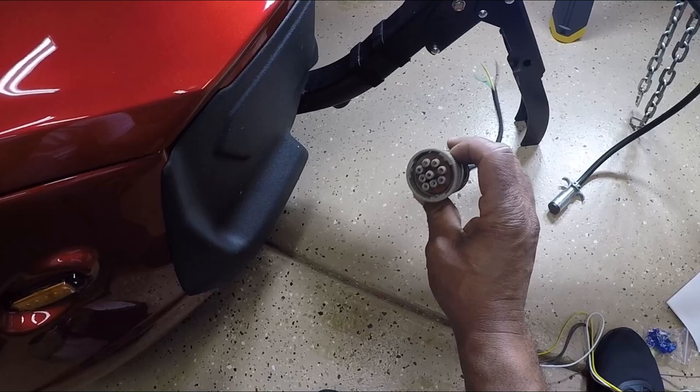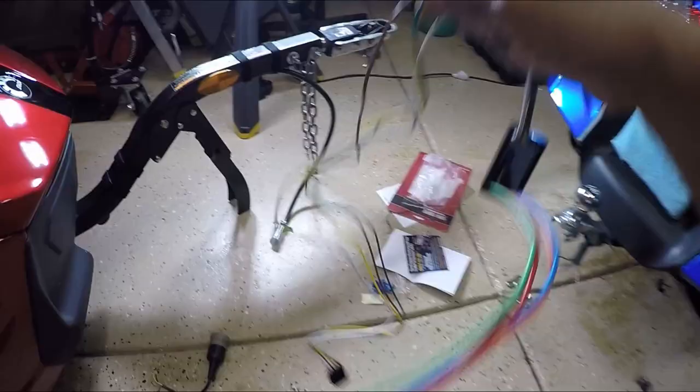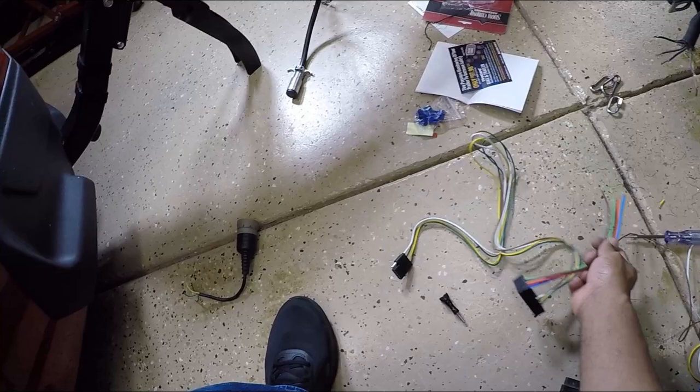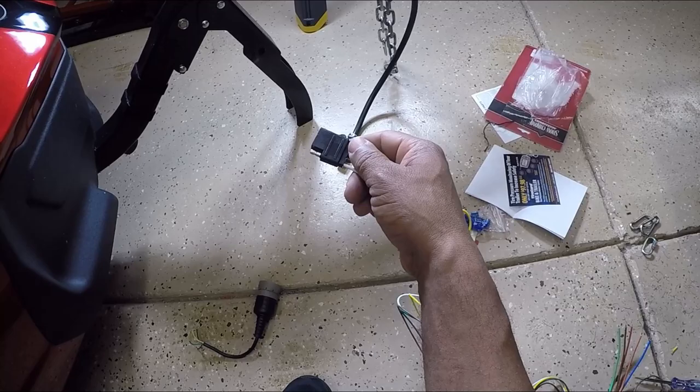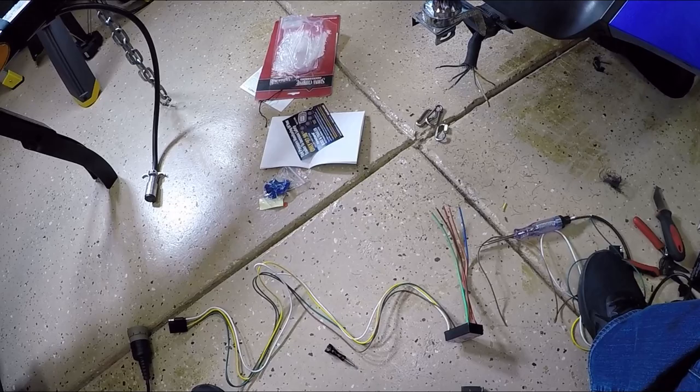So once I cut this plug I realized it was a four wire. You can actually cut the plug off your Can-Am, and if you've got four wires on your Goldwing you can run it to a four wire straight through. Or in my case, I put the converter box in the nose of the trailer, drilled a hole in the bottom, connected everything there, and ran it back to the bike. So you can see with my plug I have a six pin round, but only four wires are actually connected within it.